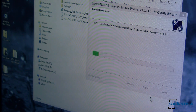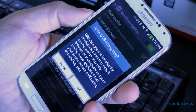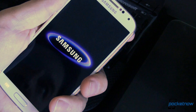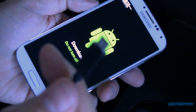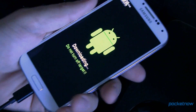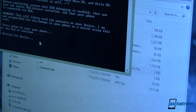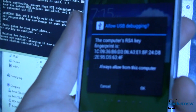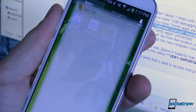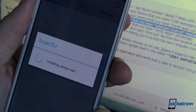Once you've got all those downloaded and extracted, the next thing you're going to do is unlock your root block. The stock ROM on this phone is root blocked, but there is a pre-release version of the kernel with a hole we can exploit to gain root. Boot into Odin and flash the pre-release kernel in the PDA section. Then connect your phone to your computer and run the run.bat file from where you extracted MotoChopper. You'll see a message on your phone asking if you want to accept a new computer connection — select Always and then OK. Once MotoChopper has run, install the latest version of SuperSU from the Play Store, open it, and update the binaries. That step is really important — if you forget to do so, you will lose root on the next step.